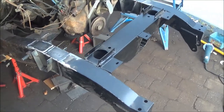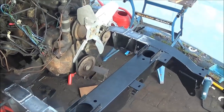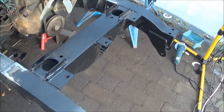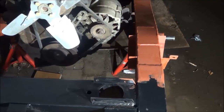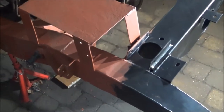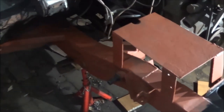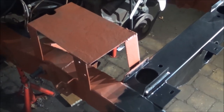All the welding is finished. I've just dressed up the welds — they can look a bit nicer when it's got a coat of paint on it. So job done for that stage. I've finished all the welding on the Land Rover chassis, and I've added these little brake line mounts. I've refitted the battery support and given it all a coat of red oxide. Now it's time to finish the job off with a coat of chassis black.